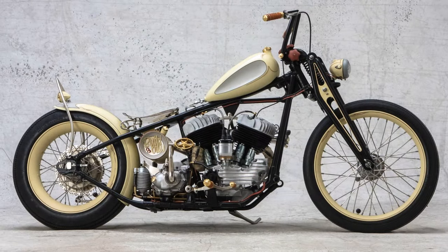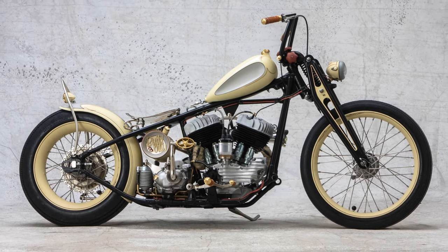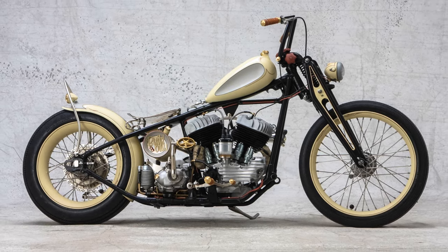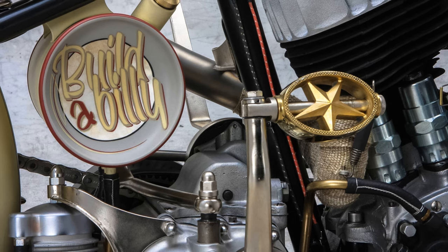Much to our horror, the battle scars of 67 years on the road appeared. Basically what was left of the frame and fork was ripe to be chucked, as some bodged-up accident repairs really left their mark on the parts. So we put the frame in our frame jig and exchanged all the tubes between the cast parts.